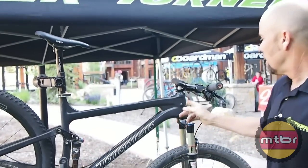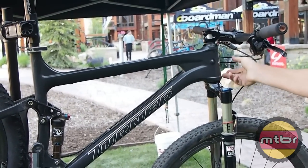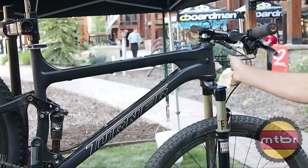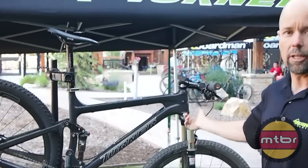On this bike, we were able to go ahead and do a 56 millimeter lower head tube so that you could use a tapered fork and then fully hide the bearing, which obviously looks, I think, really good.